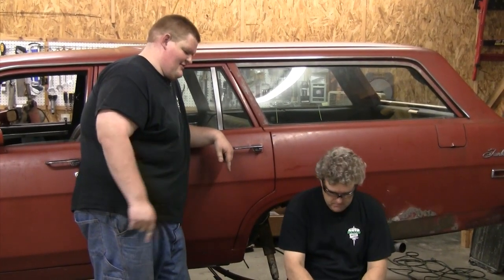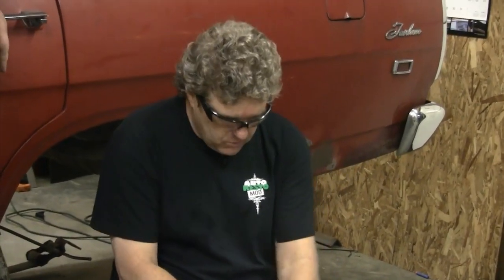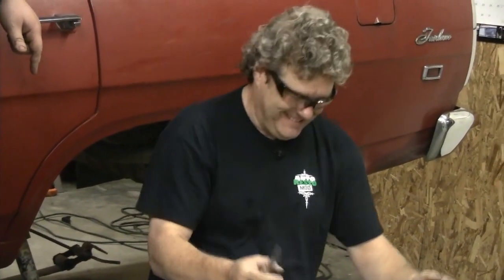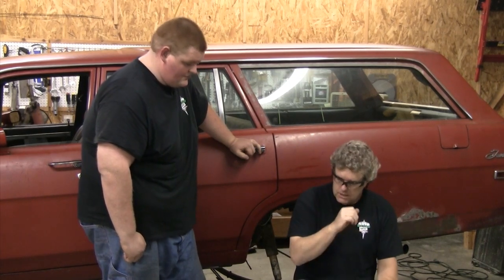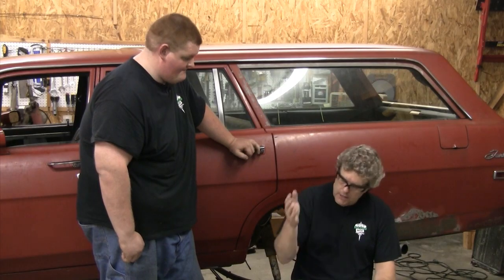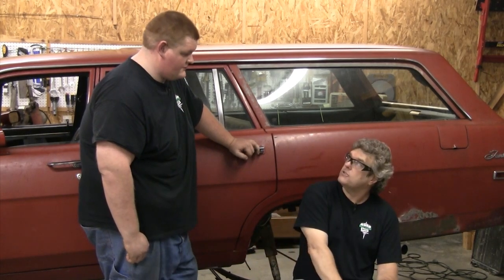You know you're actually supposed to be cleaning it, not cutting it to pieces. That's actually grease from when that pinion bearing was slinging. In order to get down to what we want to do and find some of the archeological stuff on here, we actually have to make a dig — you've got to dig through the eons of dirt and oil. A lot of times these axles will have paper tags on them, typically down on one side or the other of the axle tube, wrapped around it so they would know which axle housing went with which center section.